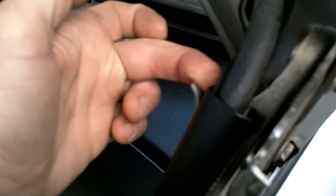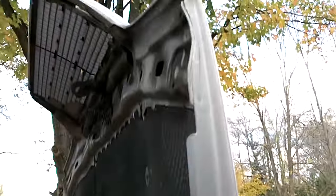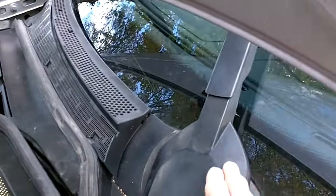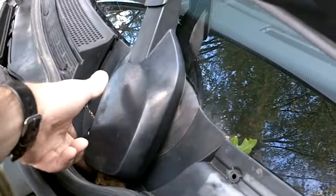Put your hood in the furthest upmost, upright position — pull the little lock pin out and put the hood vertical. Then turn the windshield wiper on, turn the key on, and turn the key off when the windshield wiper is straight up and down. That'll give you access to all the screws and everything in here.